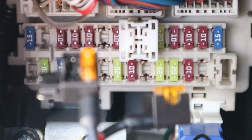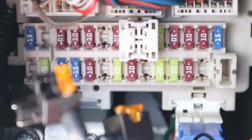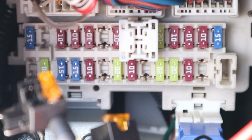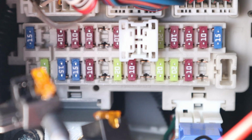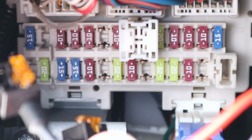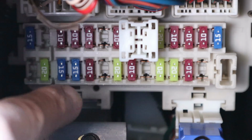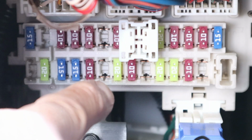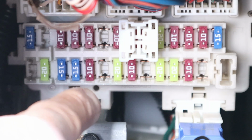For mode 8, both of the fuse taps are going to be installed to a switch fuse. So the ACC wire and the BAT wire are both going to be on there, because in this mode, when you turn the car on, the power will only be available for the fuse taps when the car is on, and when the car is off, it turns off the fuse. So we pretty much went through the fuses, and I already know which one I'm going to use. I'm going to use this spare here, and I'm also going to use the 15 amp fuse.